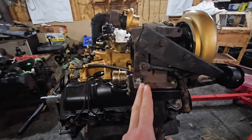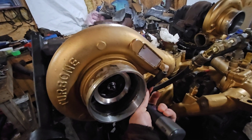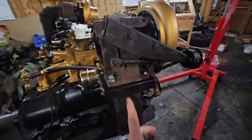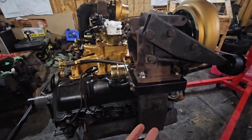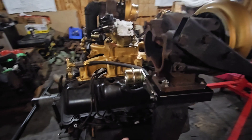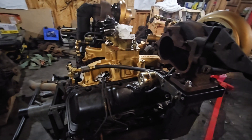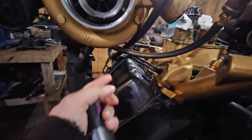As boost starts hitting on the compressor side, it comes from this little valve — I don't have a hose clamp on it yet — and goes into this wastegate, which opens up both sides of the valve allowing full spool at higher RPMs. That way you don't have high drive pressure; it equals things out, makes it more drivable, better fuel efficiency, better power down low. So quick spool valves is number one.